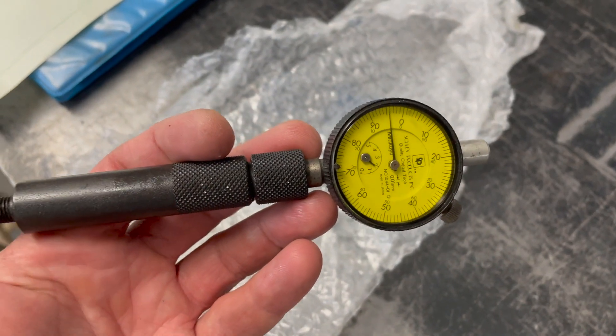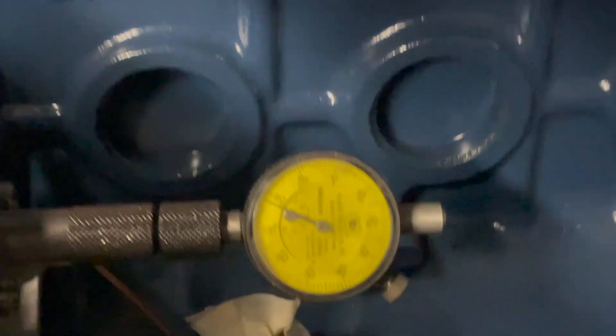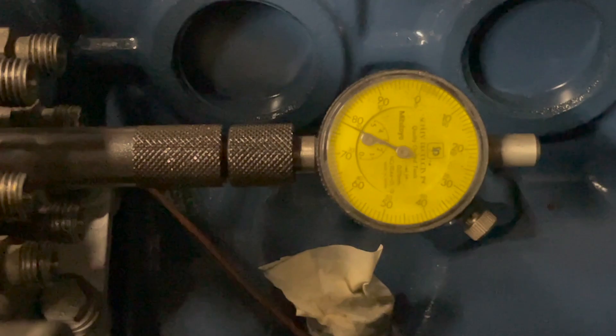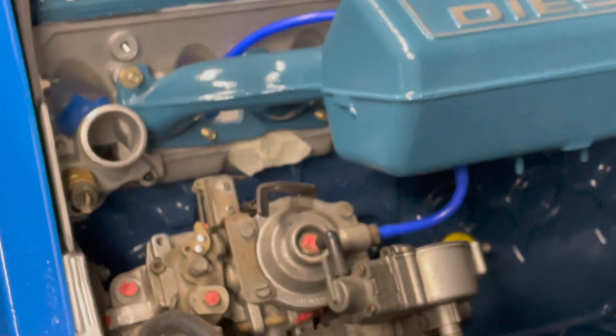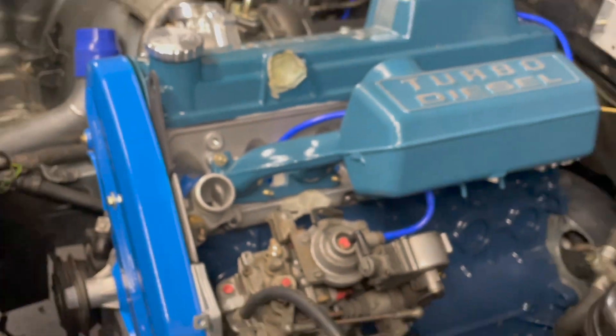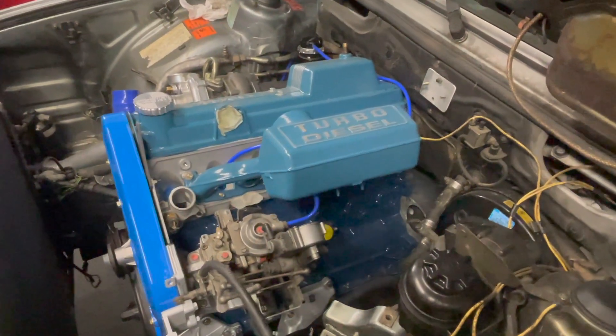There are more complete kits available — this one's a Motoyo brand top dead center tool. The spec is 0.78 millimeters off the seat. The reason for that is because the engine is a 2.8 liter and it's also going to have a couple more pounds of boost. My father was kind enough to come out and help me set the pump timing.